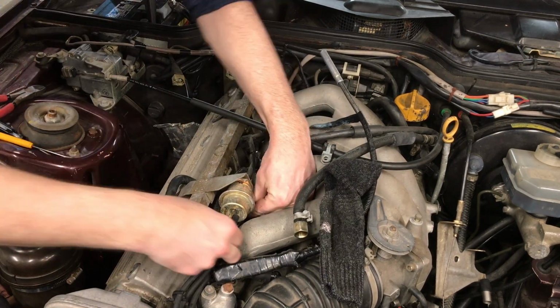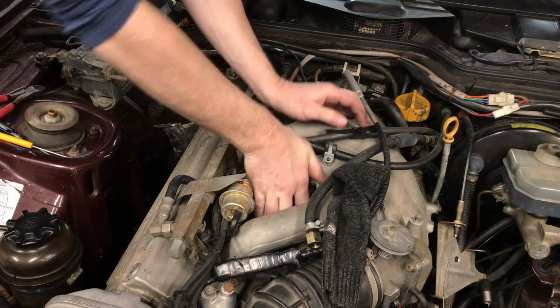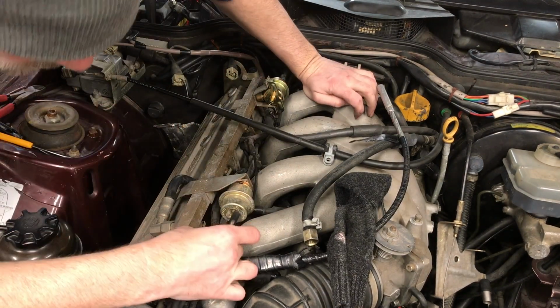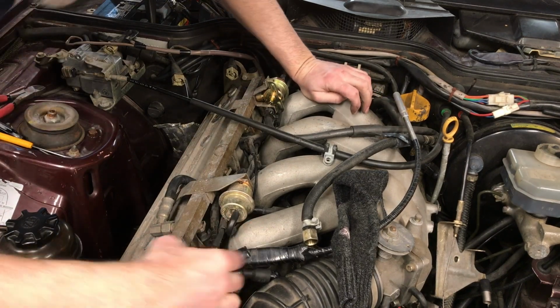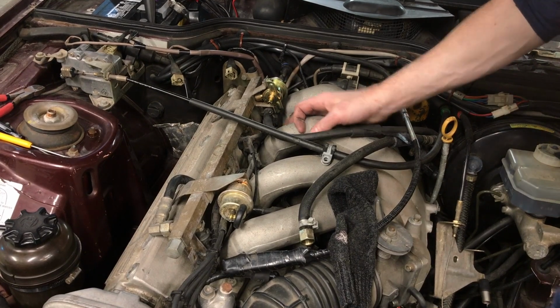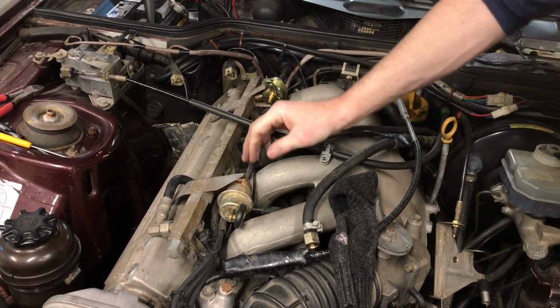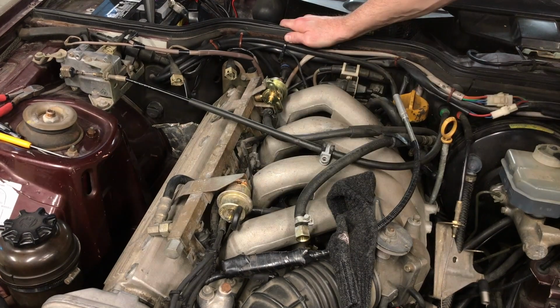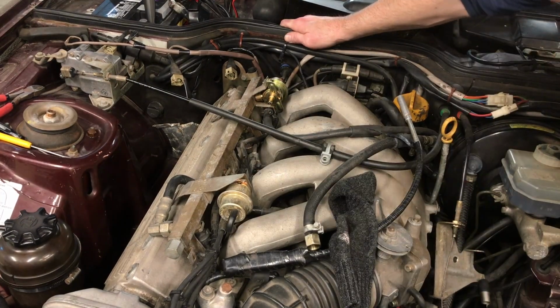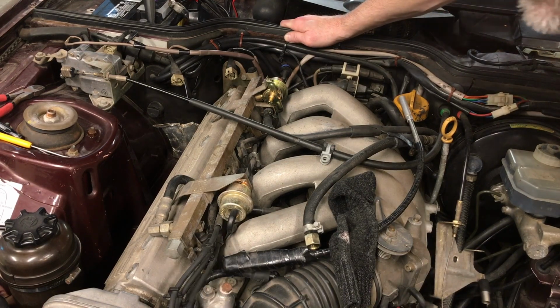Okay. I meant to pull this spark plug wire off. It says to pull all the spark plugs off, but is this one going through? It is going through there. I don't know if they make a tool for this. I bet they do. I bet that's what comes in the tool kit from Porsche, that thing to grab onto the spark plugs. I don't want to break it. I could pull it off of the cap and just feed it through. I think I'm gonna do that.